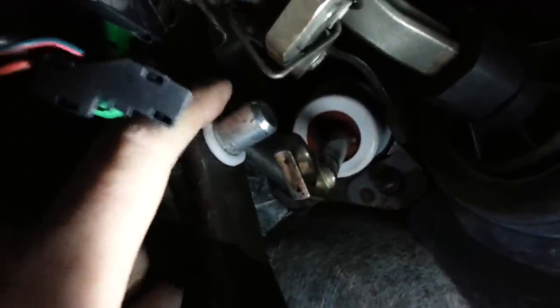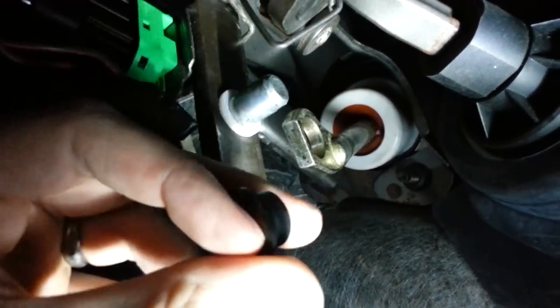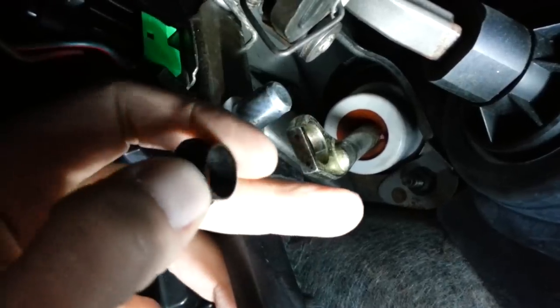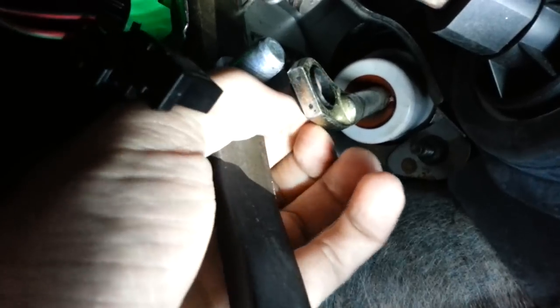Make sure that you first slip the replacement. The part comes with replacement bushings, so you slip this first bushing on right here. Hopefully you can see that. Next step is to take this, another type of bushing, just to allow the shaft to fit inside your brakes. So you take your bushing and you put it in here, and then you go ahead and you move your brake pedal down in your shaft until you can slide it over right here.